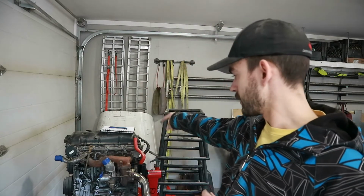I also learned, well, I think we knew this. This was our bolt for our exhaust pipe onto the turbo housing. We were using the stock bolts, just a stack of washers on them. That's not really a permanent solution. So we need to do something about the 5 bolts that hold that downpipe on. I think what I'm gonna do is look for a stud kit. I'd rather run studs than bolts because that pipe has such a tight radius, you're gonna have a tough time getting your fingers in there and doing up a bolt, if you can even get the bolt in, versus putting a nut on. So we're gonna look into a stud kit for that and get rid of our bolts.